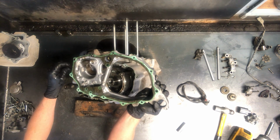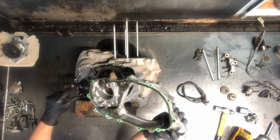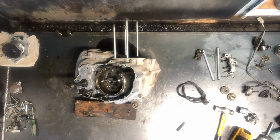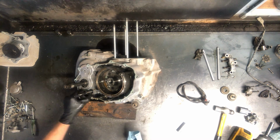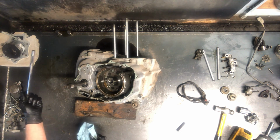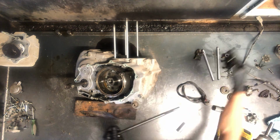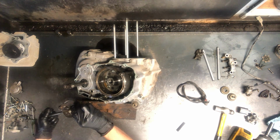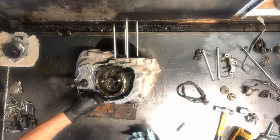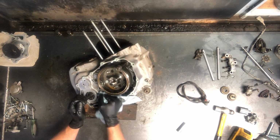There's our shift assembly here, your shift arm. Replace that gasket. The shift goes all the way to the other side. And remember that washer that I started to take off but then didn't? That would have fell on the other side now. So that went with these pieces here. So this slides onto this there. And there's only one spot that will go. Your reverse arm here, and that is spring loaded. Actually, it looks like that's not even positioned quite right.